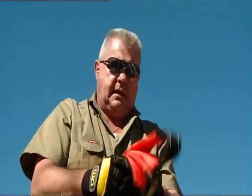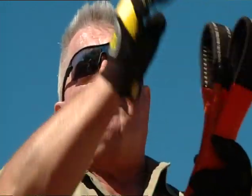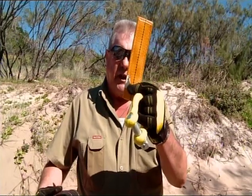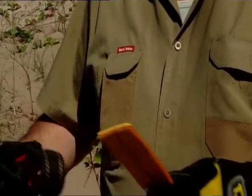Why we are going to put these two ends together is that it makes it easy to join this to another strap so he can stand off and not get into this soft stuff. When these two join, if we join them properly and then snatch, we'll never get the knot apart. Hence this little thing. I'll show you how it goes into the knot and it'll enable us to then pull our straps apart after the recovery.